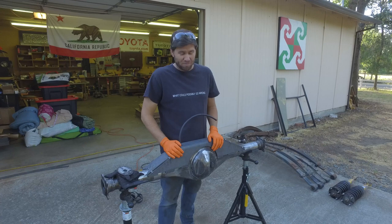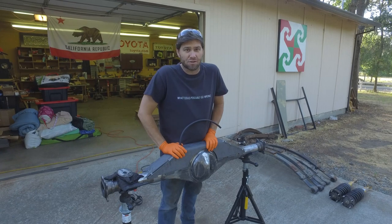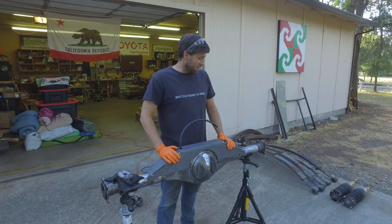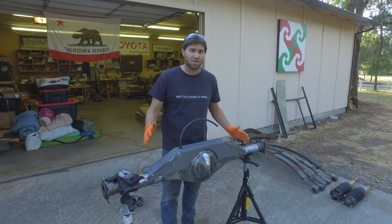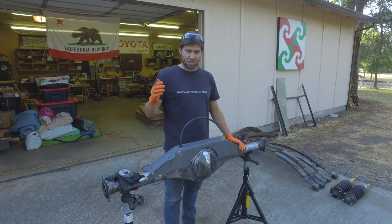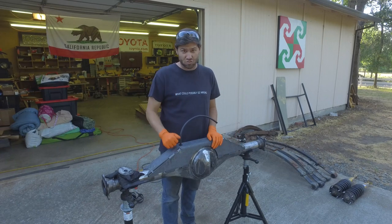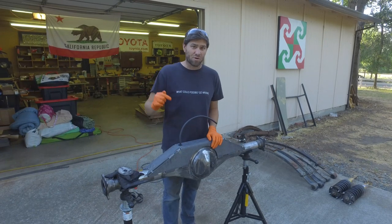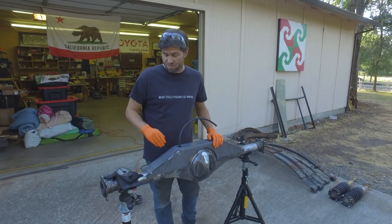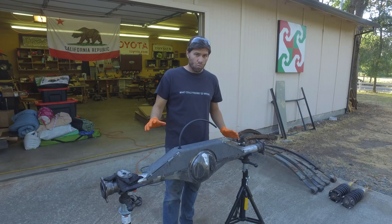A lot of you out there were probably yelling at your screen just a minute ago, and I, for the most part, am learning what I am doing. I had my good buddy Hussman come over, Hustle Nuts, Jason Hussman, and he was like, "What are you doing? Stop. Don't weld anymore." And I was like, "Why? What's the matter?" And he said, "Don't weld the truss up while it's on the axle. Take the truss off, weld it up first, then weld it to the axle, because all the heat that I'm going to be putting into just welding the truss is going to hit the axle and it could warp the axle."